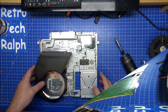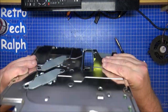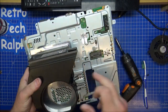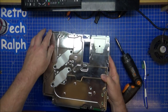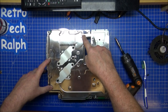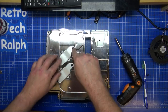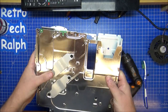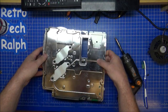Yay! Now that looks a lot better. Heat sink's on, our shielding's on, metal's on, screwed in place. Four screws on this go through before you put the board on. Board then pushes in, thermal paste underneath, five screws on here, four, five, and then you put the tension plates on to hold the board through the heatsink to the chip. Done, sorted.